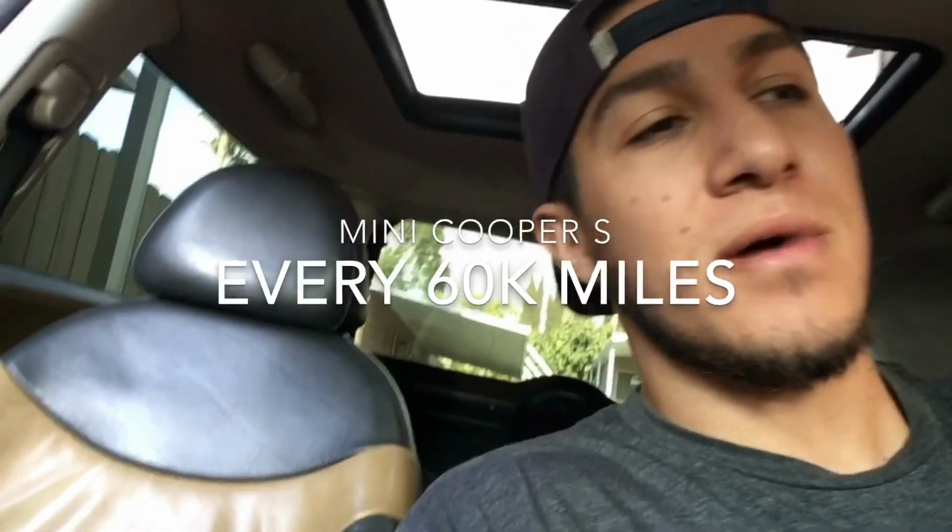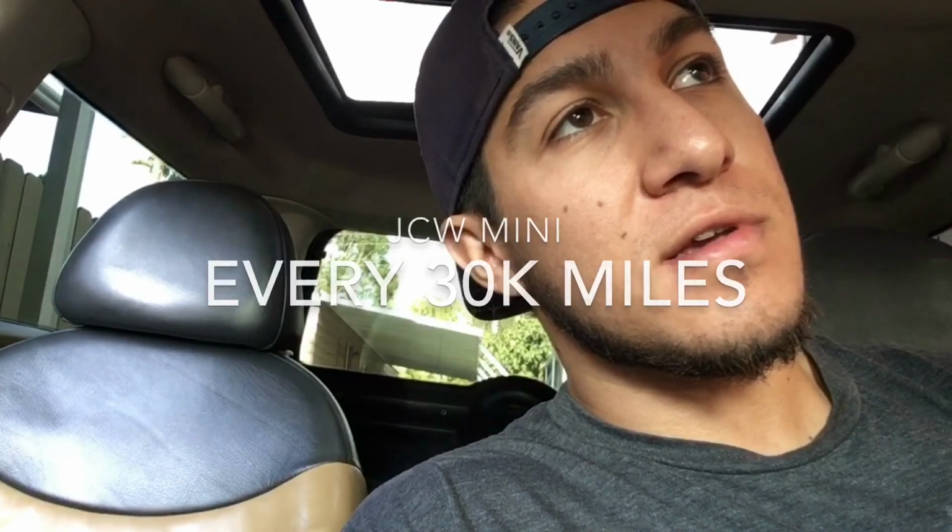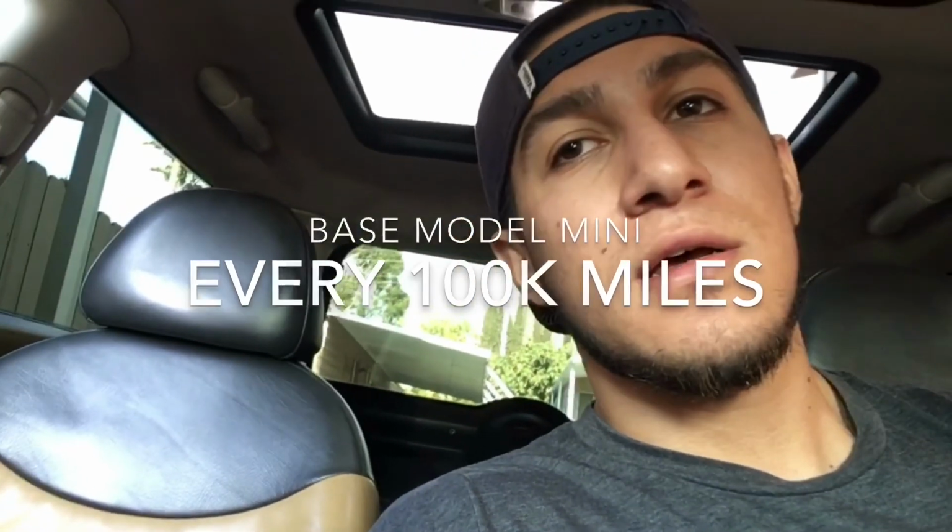But yeah, so do change your plugs every 60,000 miles in your Mini Cooper S. For JCW it's 30,000 and base model it's 100,000. Pretty simple. Make sure your car's warm. Always hand tight, hand loosen. When you put them in, give it a good half turn. Don't really crank on it and try to break it, but just a good snug turn. If you want to maintain your car, go ahead and do it. I mean, you should make it last longer. This is the most reliable model of Mini Cooper they made so far. Who knows about the new ones, but yeah.